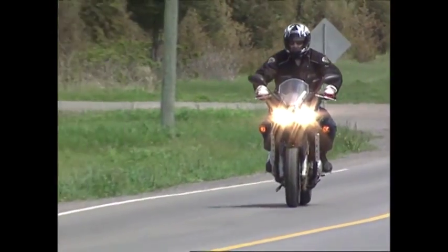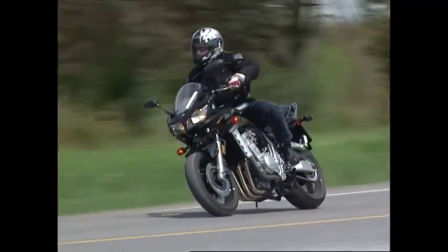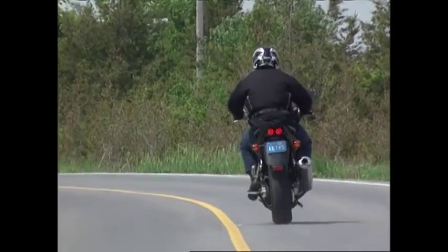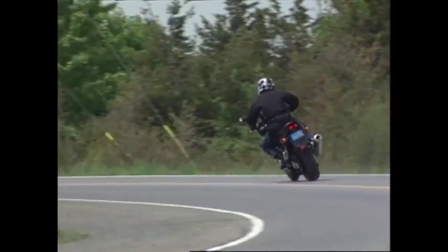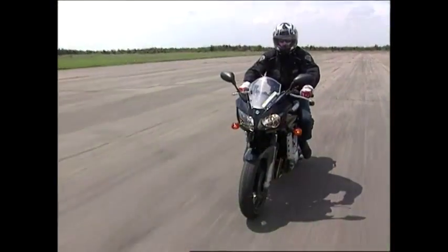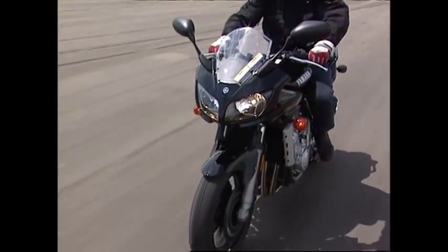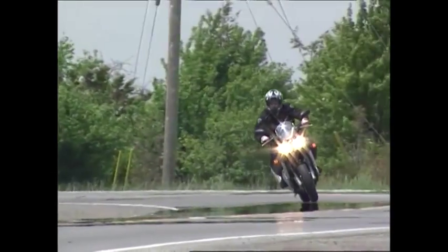Let's talk about the motor first of all. Side draft carburation, smaller carbs, they've lowered the compression somewhat, increased the flywheel somewhat. What did you think of the motor? Well, they talk a lot about detuning motorcycles to make them sort of the naked bikes. This bike has plenty of power. They have not detuned it to the point of making it boring. Would you say spirited for the motor? I certainly would. I'd agree with that.